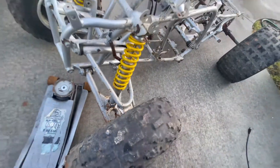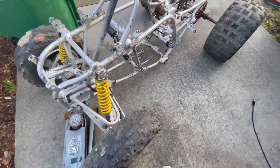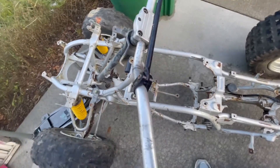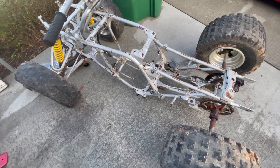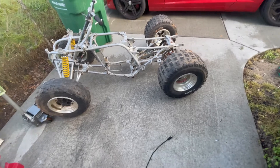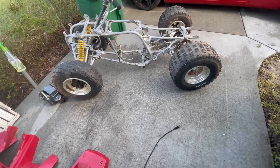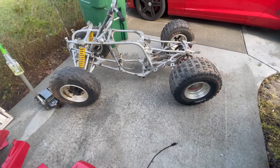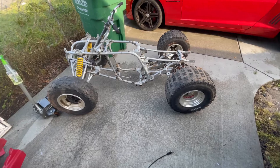I'm going to test out the brakes on my first ride. I couldn't test them out because the back brake didn't come with a lever or nothing, so I'm going to have to order a lever and a new rear brake master cylinder. But all the calipers and stuff, I still got them. I'm going to test them out, put fresh pads on them, give them a coat of paint, and see how they feel. If they're solid and cool, I'll run with them. If not, I'll just get some decent ones from Redo.